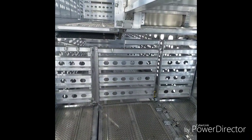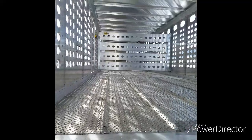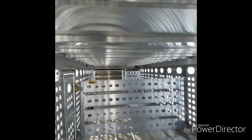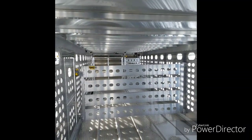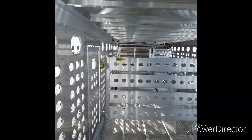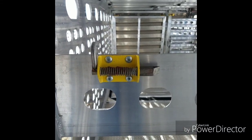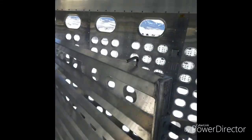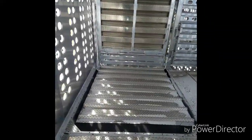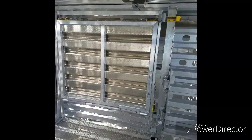The center swing gate is hinged off the road side. With this being a 14-foot trailer, I get good height in the mids on this — I'm 6'4" and I can almost stand up in here. There's your quick catch on your gate there, just like the bottom. 72-inch counterbalance, fold-down drop ramp on the counterbalance to load the 50-50.